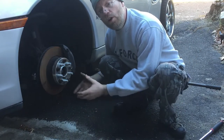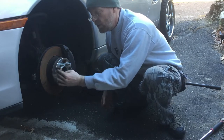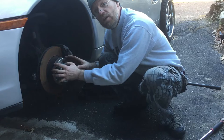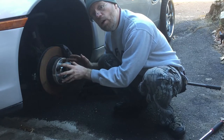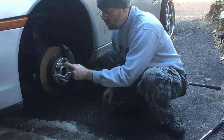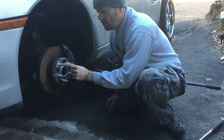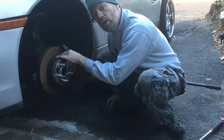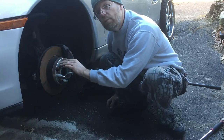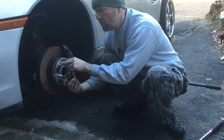Your car might look like this with the studs hanging out. Or if you have a German car, you see these studs that go inwards — that's what goes on the German car. But these are wheel spacers, which change the outside of the car. Instead of 5x130, they're now 5x112. This is a Porsche, but with this wheel conversion kit I can run those nice Mercedes rims on it. Aftermarket Porsche rims are really expensive, and these spacers are only about $100–$200.